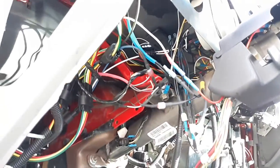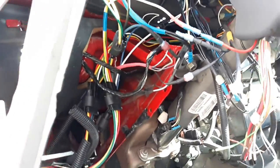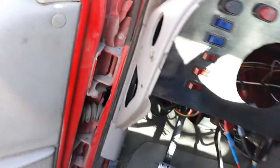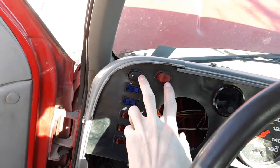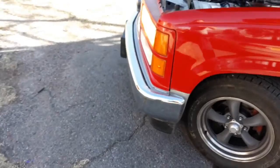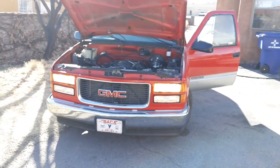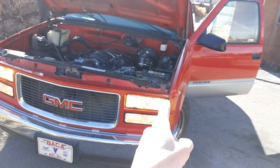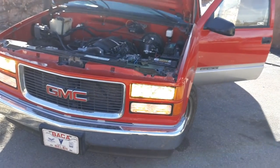My dash here is very simple — it looks like a spaghetti wire setup but it's actually not. These are all ground wires, and that's kind of what enables you to make your own harness without catching the car on fire. I haven't hooked up the reverse solenoid or the windshield wipers yet. For lighting, I've got Hella amber incandescent low beams and Supernova v4 amber high beams inside IPCW housings — that's been a huge headlight upgrade for me.